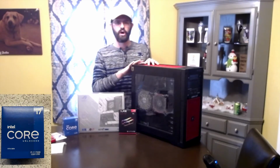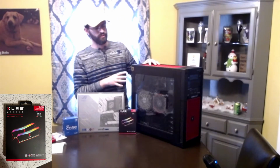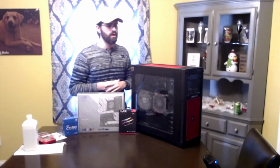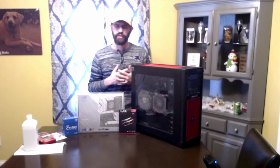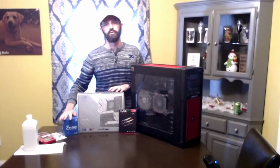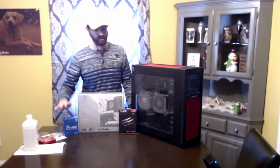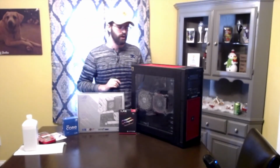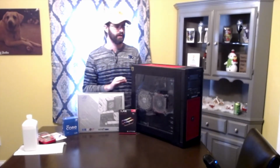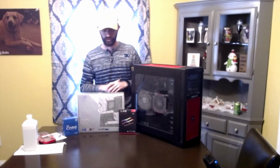And so between that water damage and the sparks from the graphics card, this computer really just needs a new motherboard. When you go to replace a motherboard, unless you get the exact same one or one that fits the correct sockets of your processor, you'll also need a new processor. And depending on the specs of your motherboard and what your processor allows, you sometimes need new RAM. So I went ahead and got all three just to be better safe than sorry, and instead of trying to mix and match some of the stuff that's already here, I wanted to get all new.